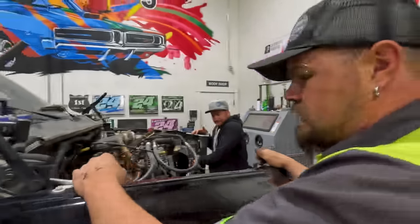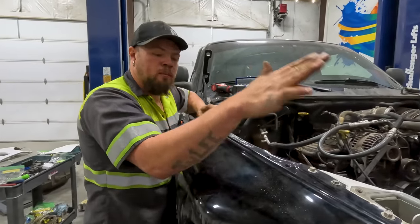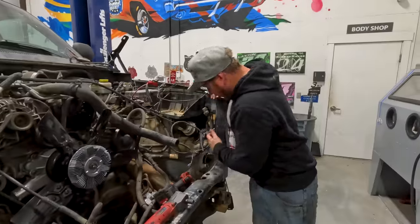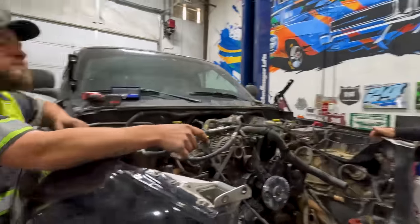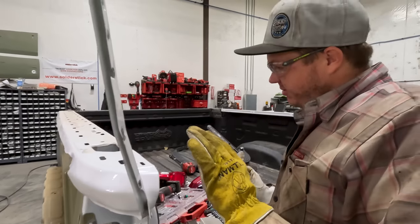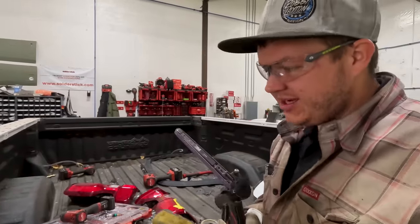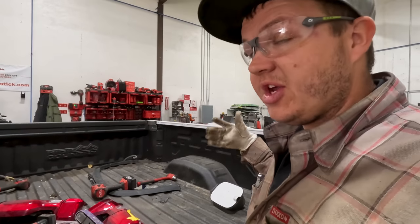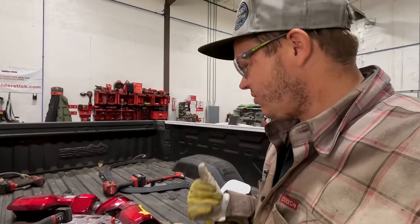We're in the process of getting the front end put back together — fenders. We're not doing the cooling system, just the bodywork part of it. Got my fender on and tightened up, four more bolts and then we can put a hood on. Putting the white one on — it's going to be a Dalmatian. The edge is all taken off. Now I'm going to get up inside the bed and go across the top — get the upper rail removed and then everything's removed for the bedside skin, enough to show the insurance on that side. We'll finish the R&Is — remove and reinstalls are parts that you remove and then reinstall after paint.